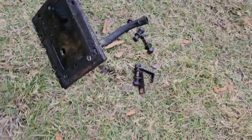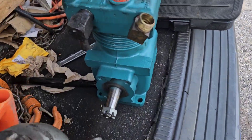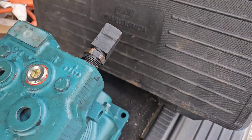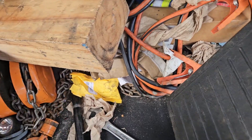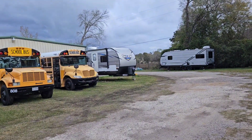I got the compressor off and this gasket still looks good. What I'm going to do real quick is bolt the new compressor on — I've already got the fittings transferred. We got air, water, water, and then we'll put the governor on here, and we'll put our intake on over here once we get it mounted. Kind of fighting storms right now, so more to come.